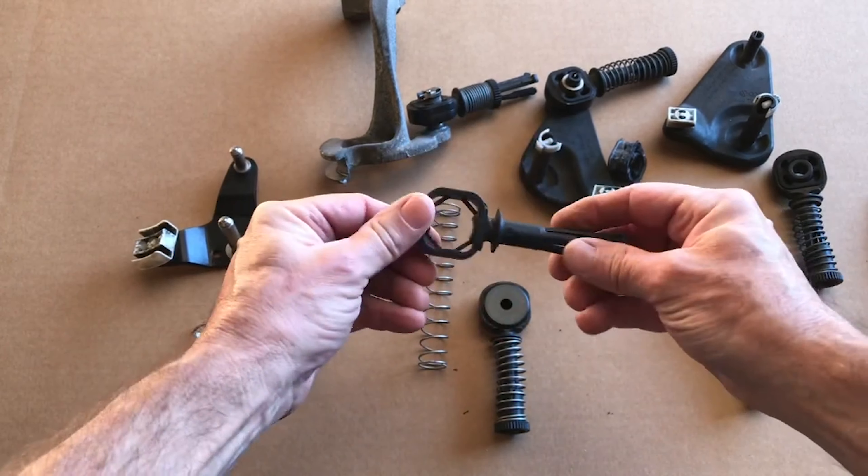This is the fine tuning video. I'm not entirely happy with that shifter adjustment — first, second, and reverse all feel less than awesome — so I'm going to show you another take on the alignment. We're going to start with an elevator test. You'll either need a helper or put your phone in the engine compartment to take a video. Basically, go from neutral, just to the left over to the wall, then into first. You can see the bell crank kicks forward and the front-to-back bracket kicks down — that tells me the effective length of this cable is just a little bit too short.